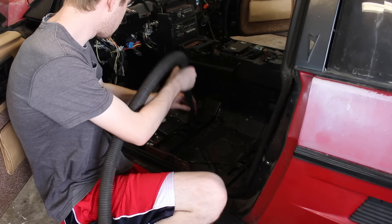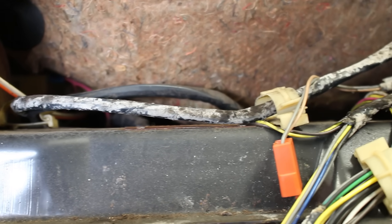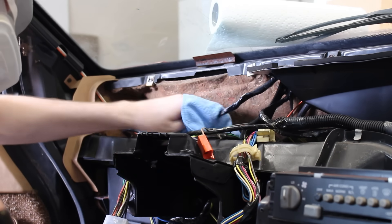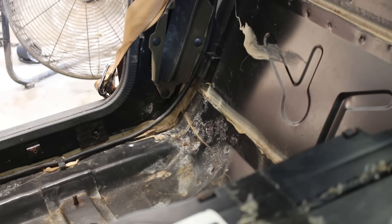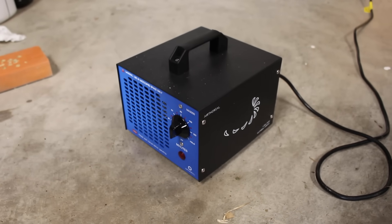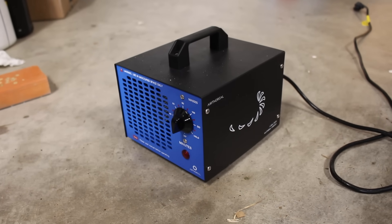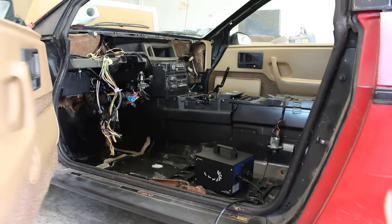With those mechanical issues taken care of, it was time to go back to cleaning and tackle the biggest health concern — the mold. There was so much mold, but interestingly only on the lengths of wiring loom covered in electrical tape. Using that same bleach-free mold spray on a rag, I cleaned every trace of mold I could find, but I probably only got around 90% of it. To be extra sure, I bought an ozone generator and ran multiple cycles in the car. This will kill all mold — and you, if you are in a confined space with it running. This is not a joke. Use it with caution and the fullest understanding of how it operates.